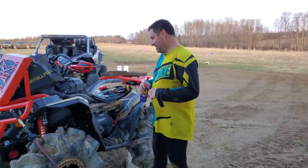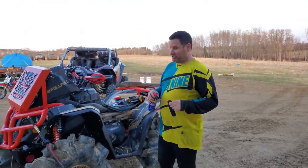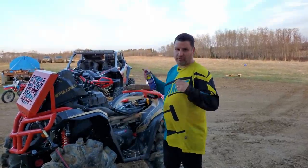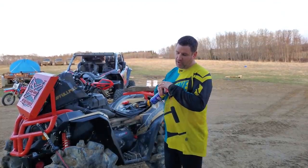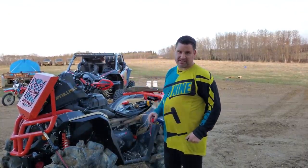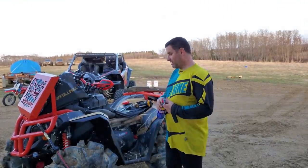Quick call to Blackie, and basically he has the same thoughts as I do. We're going to spray the top end with just a bit of WD-40, crank it over with the plugs out again, and then put the plugs in. Now that the water's out of the top end, it's not hydrolocked. It'll start. We'll run it for 10 seconds and check the oil to see if it's not real milky. I'm going to change the oil filter, and I'm going to send it.